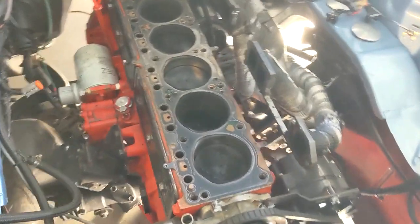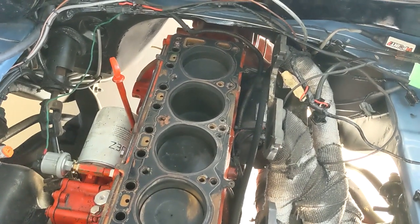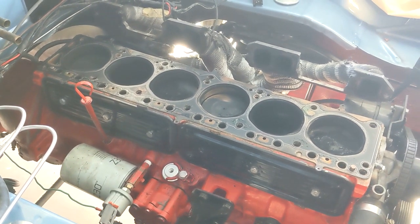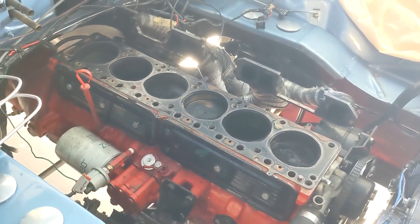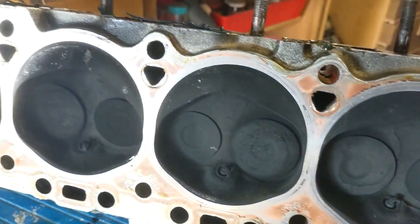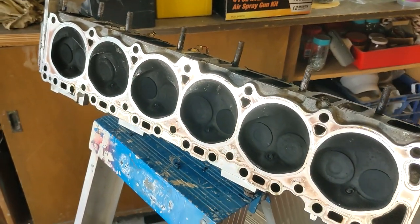The head's off and out. I haven't found anything super obvious with this bottom end. The pushrods all seem to be straight, and the pistons look okay in there. One thing I do want to look at is pulling out the hydraulic lifters, checking I haven't got some gunk in one of them. But in general she looks okay. There are lots of carbon in the combustion chambers — she's been running incredibly rich, I would think. There were a fair few shed starts and not a lot of big runs to burn any of that out.